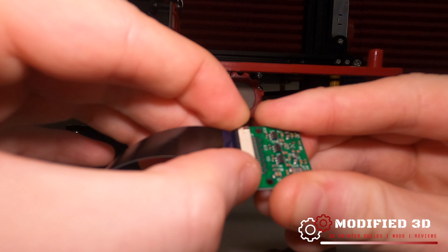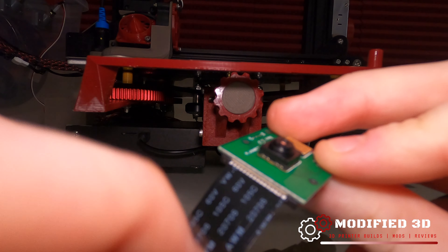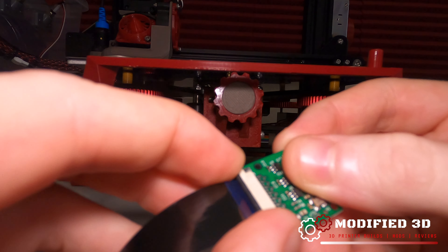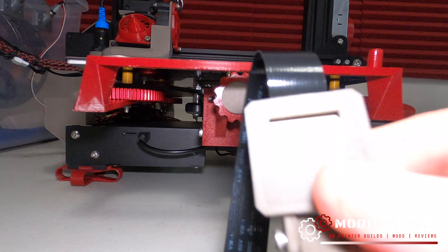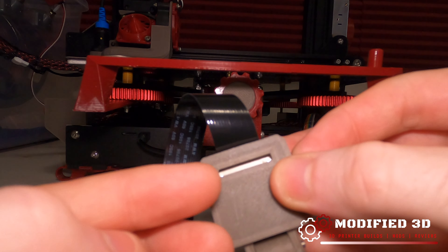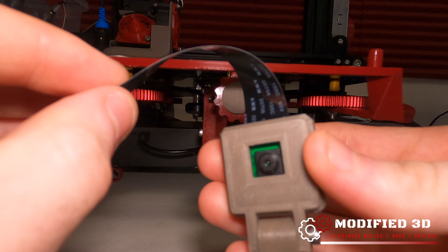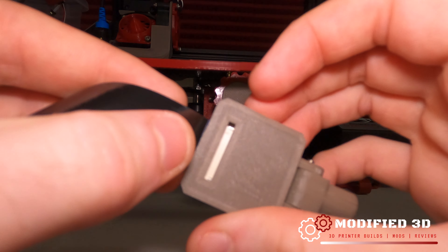We want the blue side, or whatever the tape side is, facing up, and our metal side facing down. It may be easier to do that without it in the case. As you can see, it just slides in and pushes in. You want to make sure that black piece is pushed all the way down so we have a tight connection. With mine, it was actually easier to come out the top port than to do a sharp bend and go out the back.